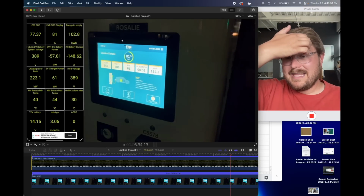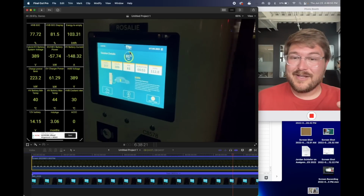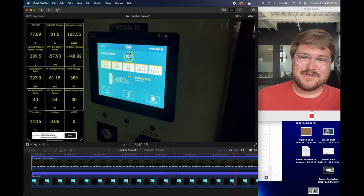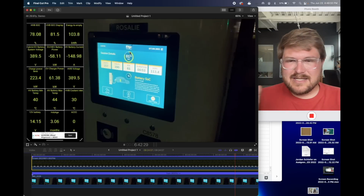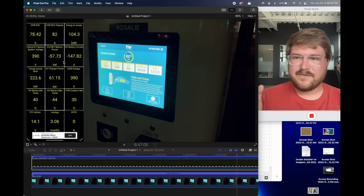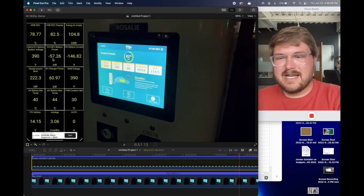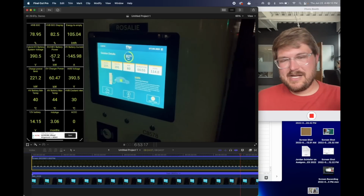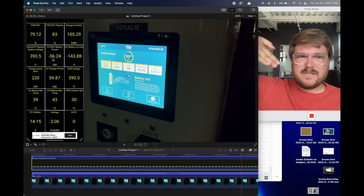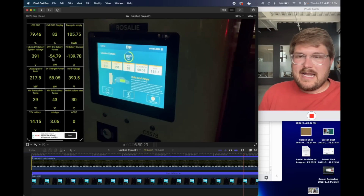So here we are, we've hit the 80% ledge. If you remember in the Mustang Mach-E, 80% would go to 12 kilowatts on the early software. Now it goes to 40. Here, there is still sort of a ledge. It does about 60 kilowatts into the battery pack. You can see here 57. But what it's doing is it's sort of coming off. By the time we reach 90%, though, we'll be around 20 kilowatts. So as soon as you hit 80, it's a downhill slope. And I'll show you the charging curve at the end of this.